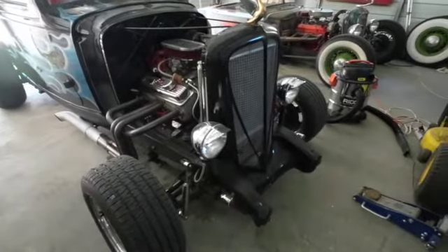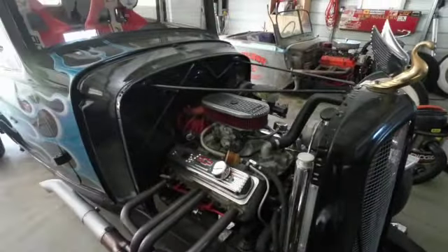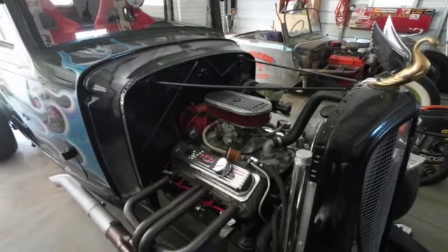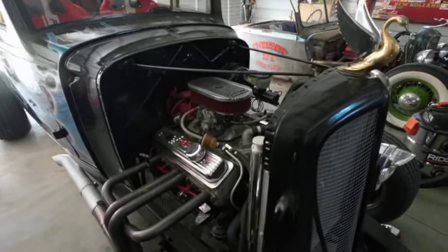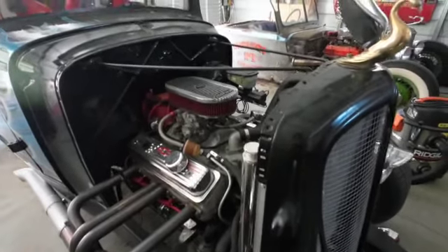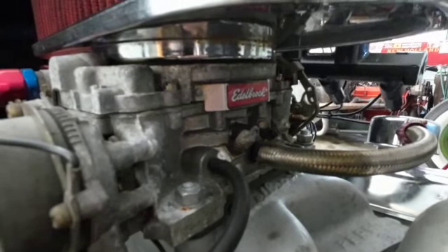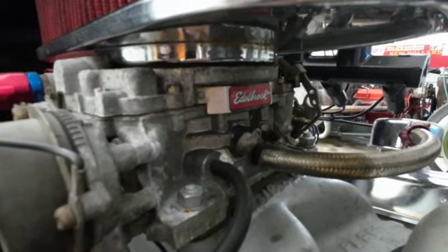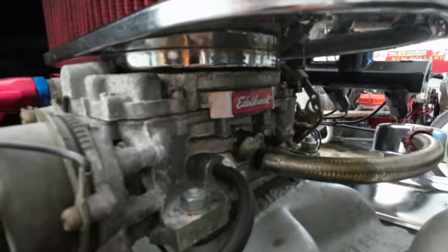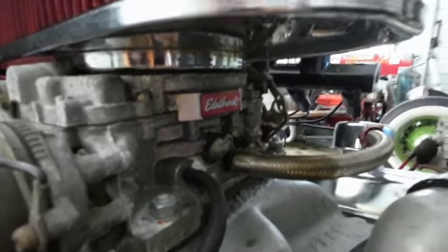The other day I took this beauty out for a ride and she was sputtering a little bit on takeoff. There are various and sundry things that cause that, but I've generally found that if I've got a carburetor of this type — this one is an Edelbrock, which is basically the same thing as an old Carter AFB — generally, a lot of people talk about rebuilding them, but I've found that if I just take it apart, clean it real good, clean out all the little passage holes and stuff like that, put it back together, it works pretty good.